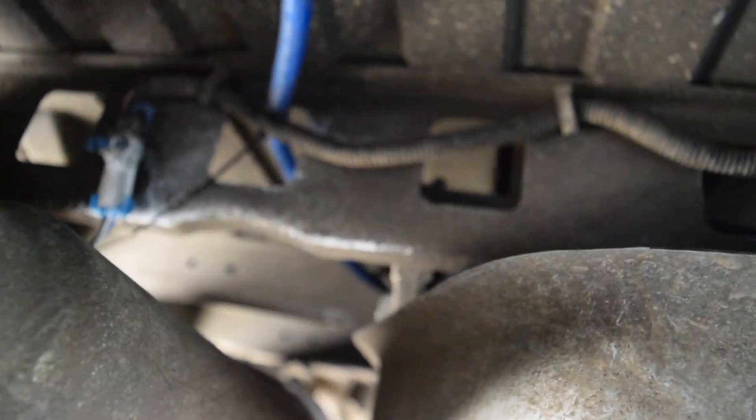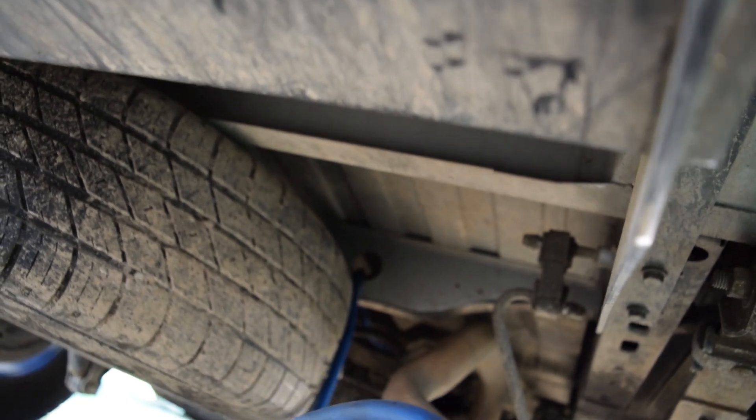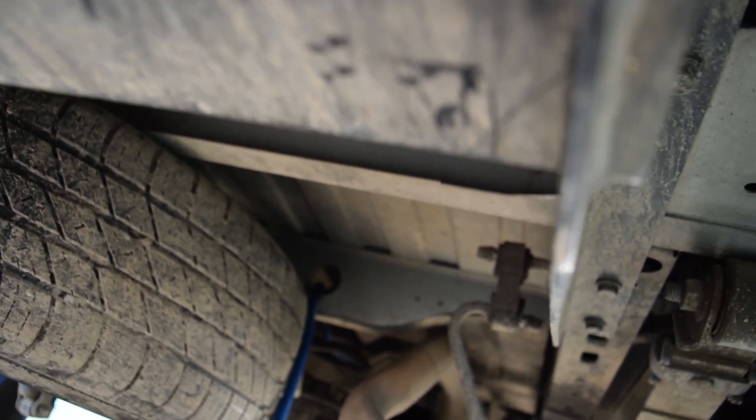The wire goes through holes in the frame rail — see that hole right in the center of the screen — it goes through that rail all the way through. It ends up coming out right here, and what I'm going to do is drill a hole, use a rubber grommet so it doesn't rub, stick the wire through, cut off the excess, attach a fuse, disconnect the negative battery terminal on the auxiliary battery, and hook it up.